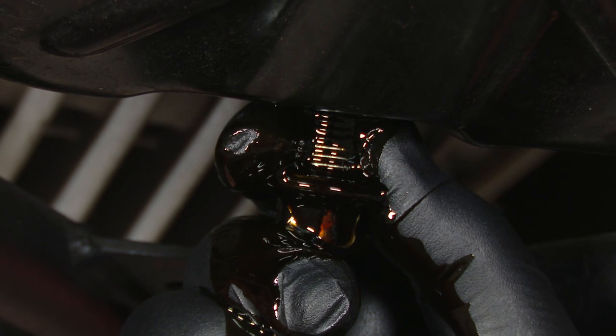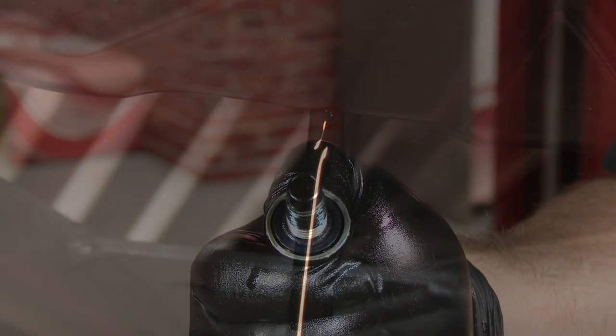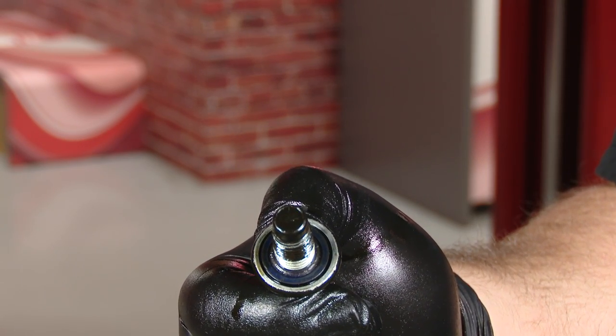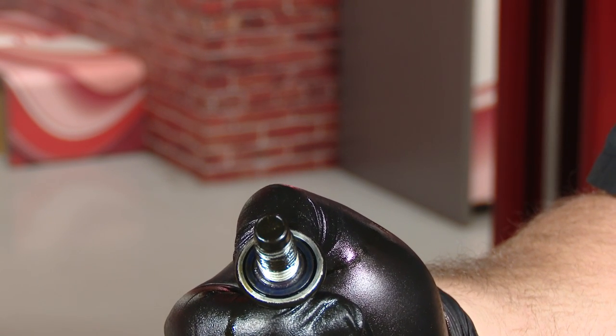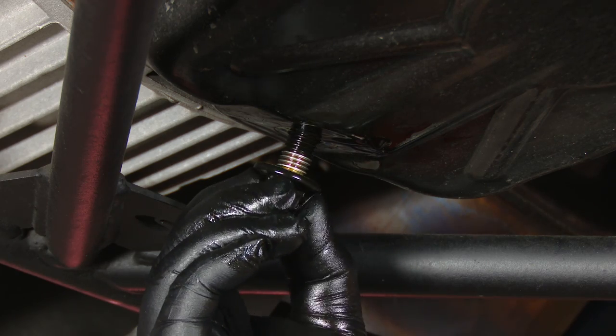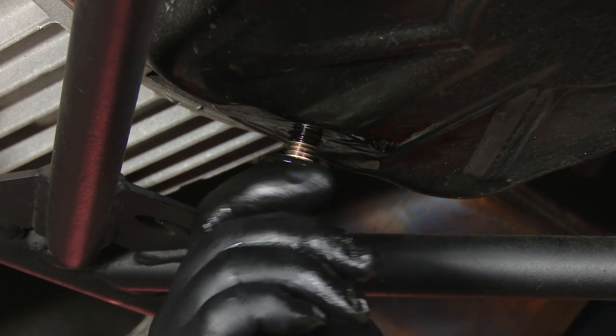So I have all the threads out — it's kind of loose. When you remove the drain plug, take a look at the bolt and the seal and make sure it's not damaged. If it's leaking or if it's damaged, replace the bolt if needed. But in our case, the bolt and seal are good, so we're going to reinstall it. Now that all the oil is drained, we're going to reinstall our plug. Thread it in by hand first — you do not want to strip the threads on this oil pan.